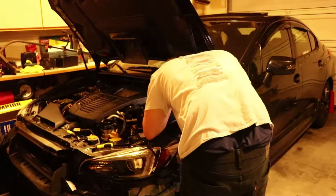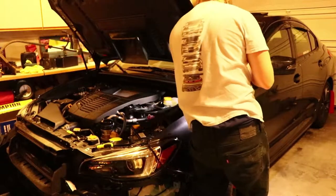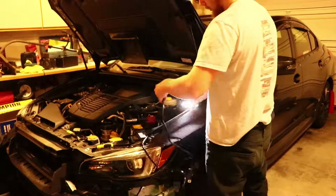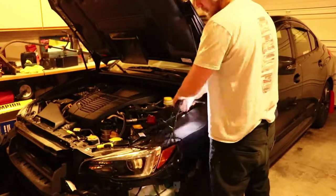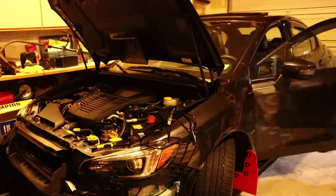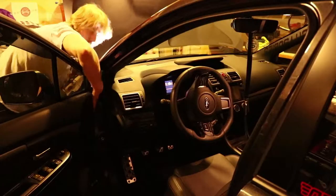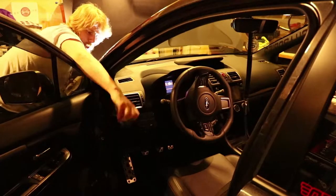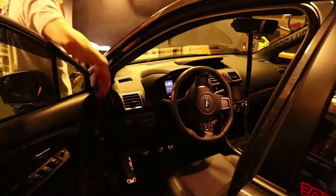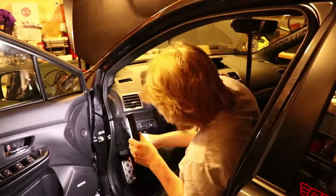After that, you're going to go into the fender well, and this is the point that moving your wheels is key, and you're going to remove your fender liner from the driver's side, and that's going to reveal where the wiring harness now is. And you're going to open the driver's side door and pull the rest of the wiring harness through the fender and through the door. You may not need to take the fender liner out, but it's going to make it much easier.